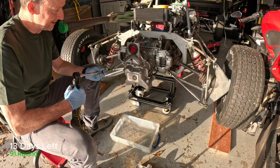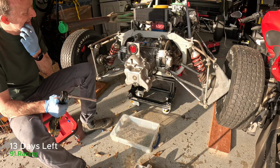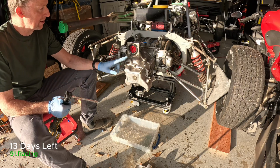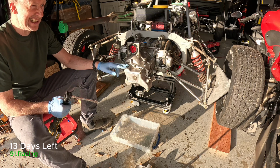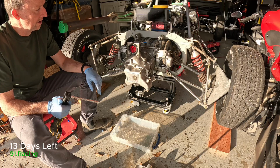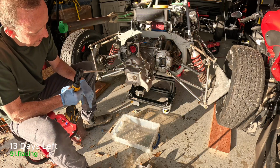All right, let's tackle the thing that I am most nervous about, which is this Hewland gearbox. If you know anything about Formula Fords, they all use Hewland gearboxes. I think there's two types of the Mark one, they call Mark 6, 7, and 9, I think. And then there's an LD200 on some of the newer cars. So as you saw, we're struggling to get third gear, so we've got to get inside the internals and see what is actually going on.